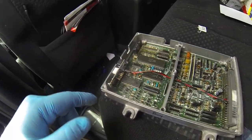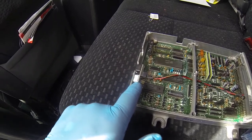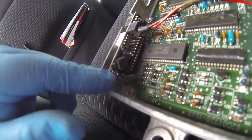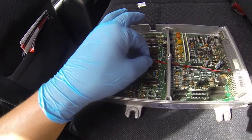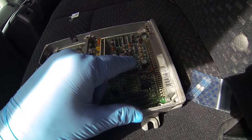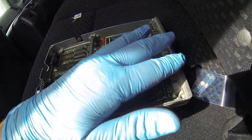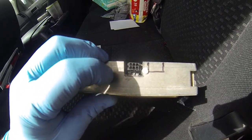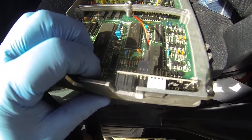I want to show you exactly the inside of the ECU, what everything's supposed to look like. This is the ECU right here - this is the controller, soldered onto the FC1 board. You run two wires to your A21 and A25, which is signal and power. Then I have to cut the hole right here and drill the hole for the stabilizer screw which sits right there. That's pretty much the whole kit.